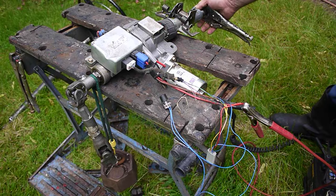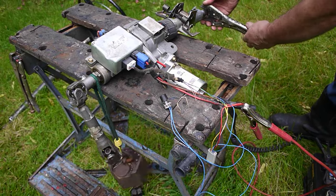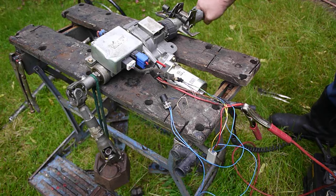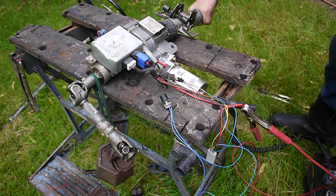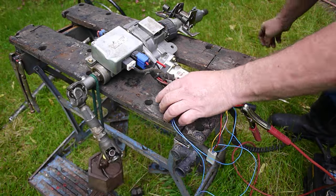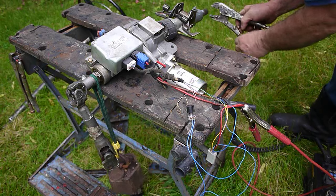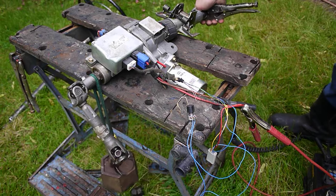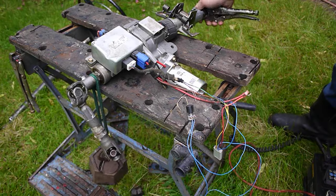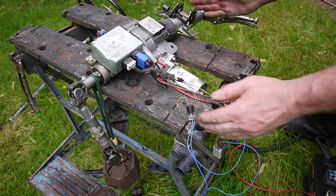...and hear the unit click to engage. Now I can do it with two fingers in the center. In fact I can probably take the mole grips off and lift that five kilogram mass without a steering wheel on, without much problem. If I turn it down it gets more difficult — I have to put the mole grip back on. Yeah, I can lift that mass. Turn it off again — and I can't lift it. So that's electric power steering.